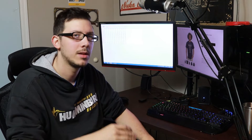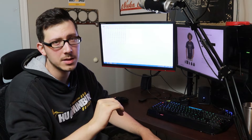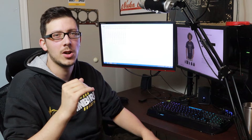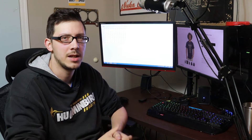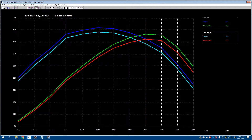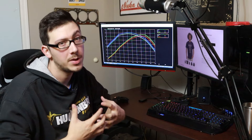Just over a point of compression and it really makes the engine wake up. 9 to 1 is about where I'd want to be — 9.5 is what I'd like, though 9.5 is pushing it with stock iron heads. 10 to 1 is really where I want to be. If you run E85 it's possible, and you can probably even run 93 and be safe, but each engine is really different. The gains under 3,500 RPM are really minimal — if you're just driving your car around and not beating on it, the lower compression ratio might actually be a great thing for you.